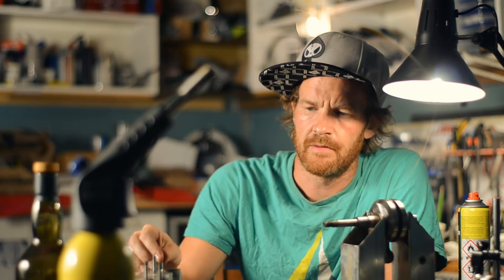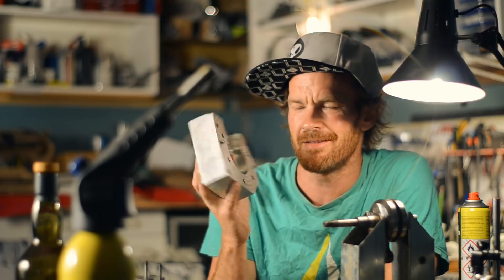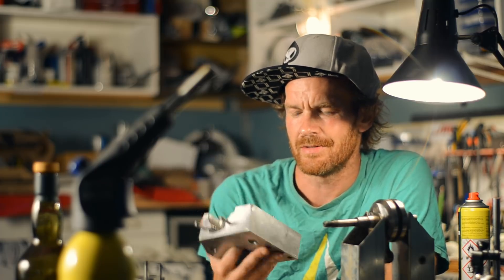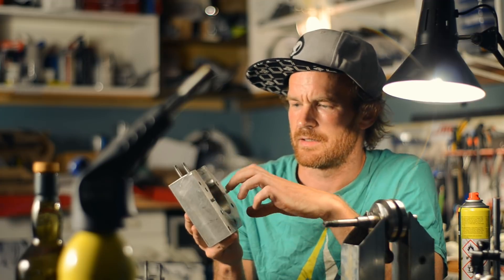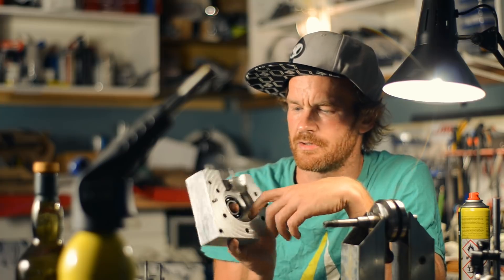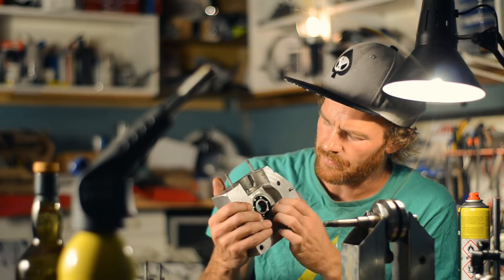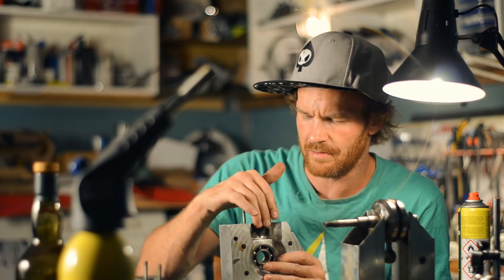A larger, beefy crank for a scooter that's meant for high horsepower — much higher than what this crank is. I'll try to get a hold of Hollanderen and see if he can help me out. It shouldn't be much of a job for someone with a lathe. It's basically just turning the diameter for the crank webs larger, and maybe making it a little bit wider.